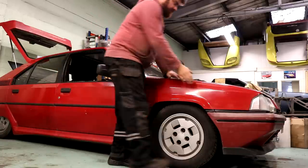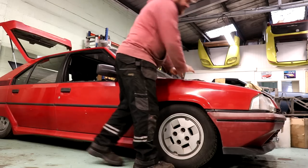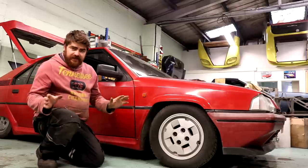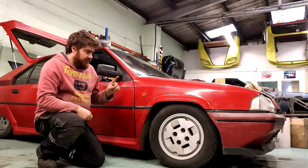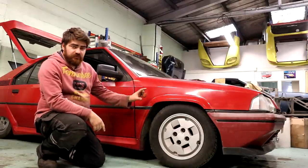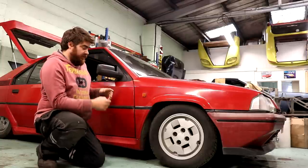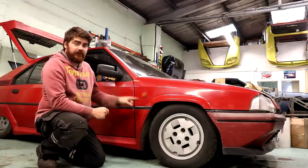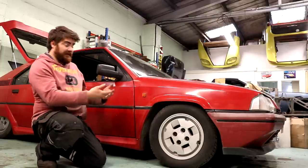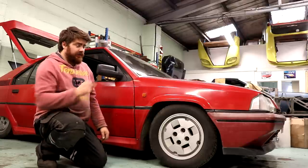You'll notice because it's sunk, there's no suspension — it's rock hard. Now if I were to jack this up the wheels would dangle, but that's irrelevant. If I put the suspension on high — as high as it goes, maintenance mode — it goes rock solid. It fully extends, there's no more travel, it goes right to the top. And when it's at that point, you can drive it on three wheels. It's nothing to do with the suspension being hydro-pneumatic or being clever — it's basically because the suspension has gone rock hard.